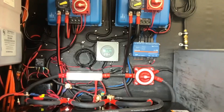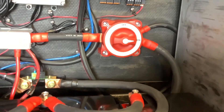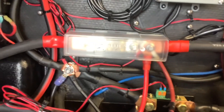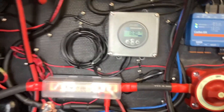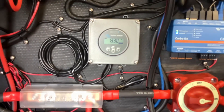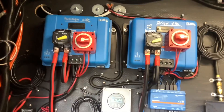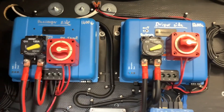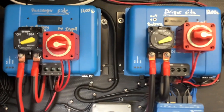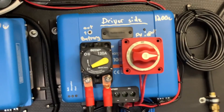We also add a main battery cutoff switch with every install so you can turn off the whole system with one switch. We also have a main system fuse which is going to protect the whole system along with the inverter, and then we have a Bluetooth battery monitor here which is redundant with the one inside—so you have one here and one on the inside. As far as the solar, we have two solar controllers here with 1,200 watts of solar on each controller, plus an on/off switch for each solar input and a breaker for the output on each one.